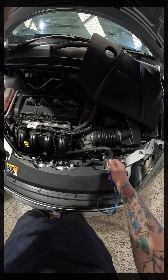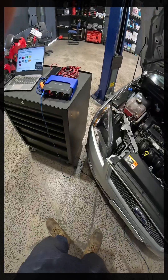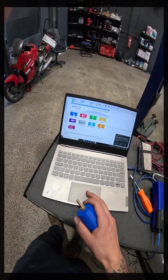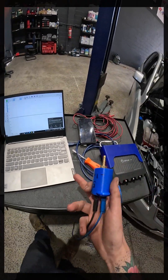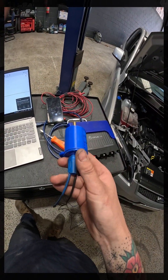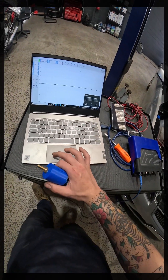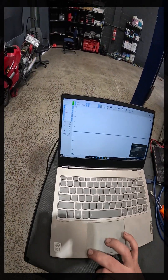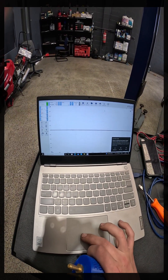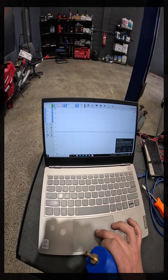What I'll do is actually show you on the scope. We've got the scope hooked up here. Initial setup is simple: just one channel, scope lead in, and you've got two wires that go into the end of your pressure pulse sensor. I'll bump that time base up.